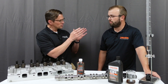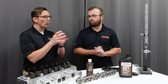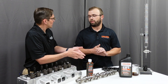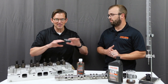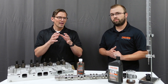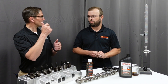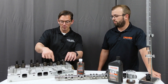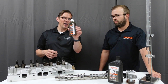To try to reduce the amount of variables, especially when it comes to piston rings and ring break-in, you need that break-in to go well. But there's something that happens before break-in that people overlook — the actual assembly process. When you're putting that engine together, you didn't put in all eight piston rings or all 16 rocker arms at the same time. You did them in sequence, so the engine is actually turning over. The oil film is a calculation called the Stribeck curve: viscosity times speed divided by load. During engine assembly, you have very little speed but you still have load from things like valve springs. So you need more viscosity to offset that — and that's where the HVL came in.